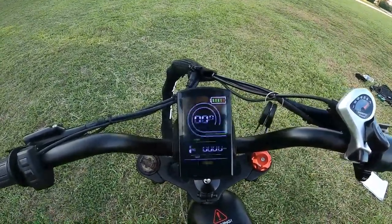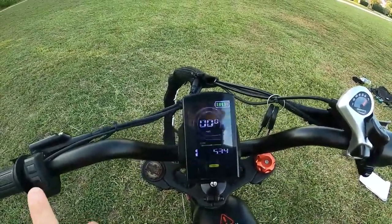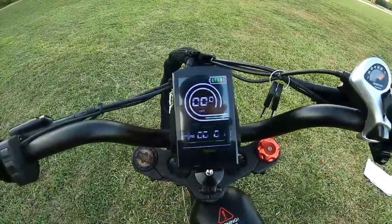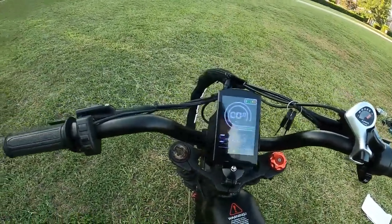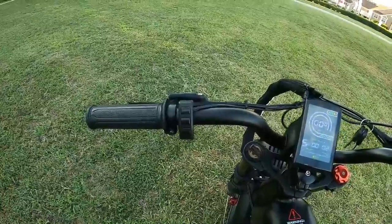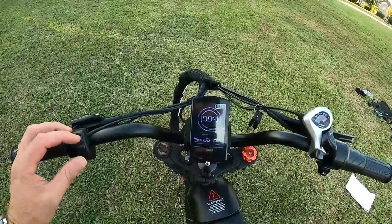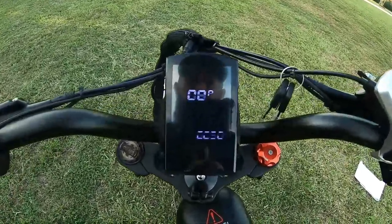The display screen shows a battery indicator at the top, your speed large in the middle, and an odometer and trip meter. Hit the button and it also shows battery voltage, which is always nice. It toggles through ride time, max speed, and average speed. Pedal assist goes from one through five. At the bottom of the display there's a USB charging port so you can charge something in the cockpit. On the other side are your pedal assist buttons, menu buttons, and power button. Hold the plus sign for three seconds to turn the lighting package on. To change the top speed setting, hold plus and minus to access the P settings — I set P8 to 50.